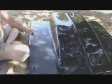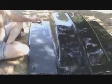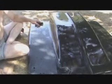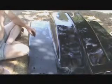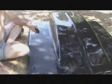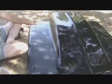But the other thing is the spray gun. Instead of using the bargain gun from the local freight discounting place, I stepped up and ordered a $100 gun, like a Sharp something gun, and they spray your paint on flatter. So if you want to save yourself a lot of sanding, get a half-decent HVLP gun.